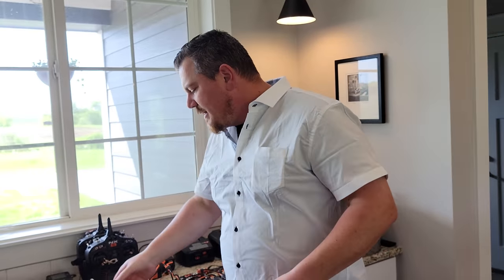Now, the other thing you might wanna do is put a magnet on here, and we do need to quickly inspect if we're mechanically bound, okay? So this is what we're gonna do next. Watch this. I'm gonna go to speed, highlight it, and go back to sub trim. Well, I'll go to travel. I'm in that position, so now watch. Now it's opened. See how it's open? I'm just gonna scroll. See, that's overdriving the heck out of it.